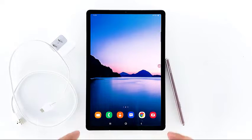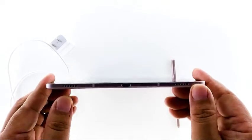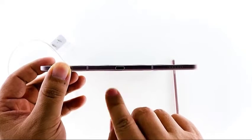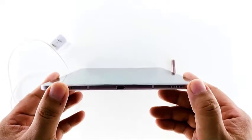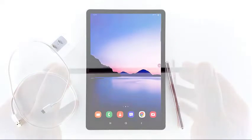The entry point of the current from the charger is the charging port, so make sure it's clean and that there's no obstruction in it. If for some reason you notice that it's wet or has moisture in it, get a small piece of tissue paper, put it in, and leave it there for five minutes or so.